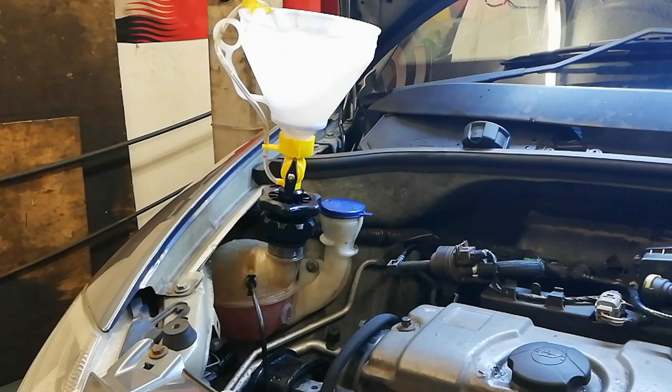The coolant in the reservoir is rising as it heats up and expands. This is normally a pressurised system with a pressure cap, but it's now open to atmosphere, and there's a small bleed tube that feeds back into the funnel. You can see the thermostat has opened and the coolant is starting to rise back up into the funnel. I'm monitoring the temperature here as well. I'll just shut the engine off now and we'll watch the level drop back down.